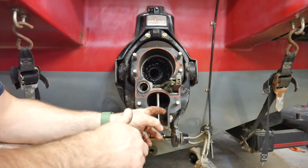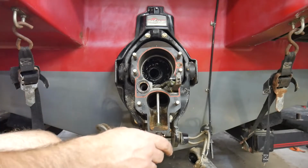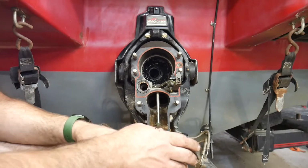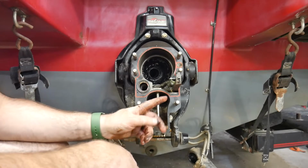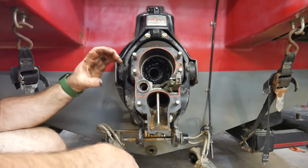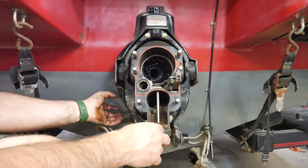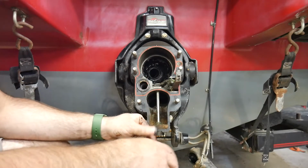Now, just one thing I want to note. So the exhaust bellows down here is broken, and that doesn't matter. First of all, this boat has through hull exhaust that come out the bottom of the platform here. So that's capped off on the inside. But no matter what, that exhaust doesn't go up and inside the boat. So there's no way for it to leak inside if the exhaust bellows is broken. Actually, some of the earlier Alphas, they just had a hose that came out and made contact here with your gimbal housing, your outer bell housing, if you will. It just was a hose that slid over. So if your exhaust is split, that's not a big deal.